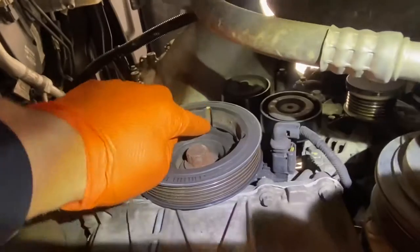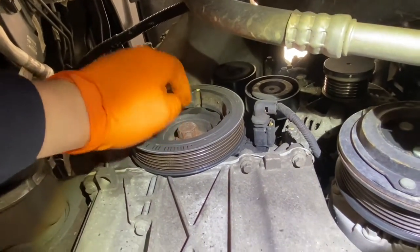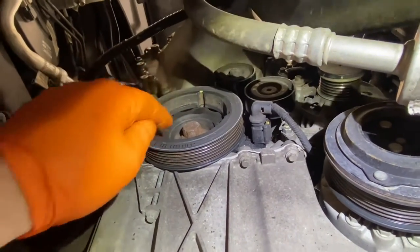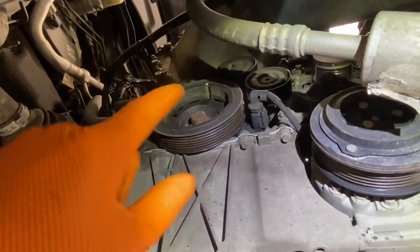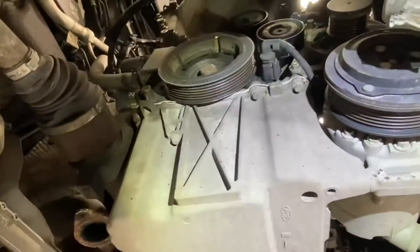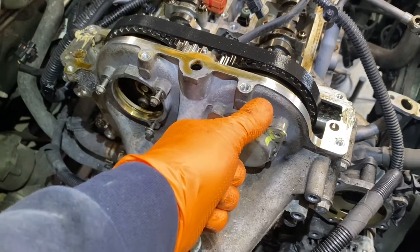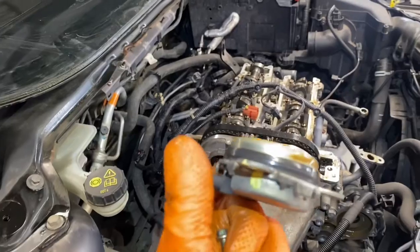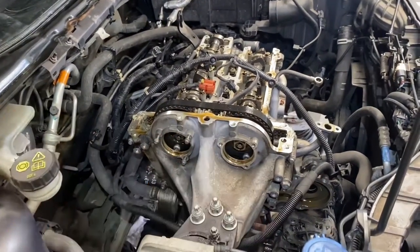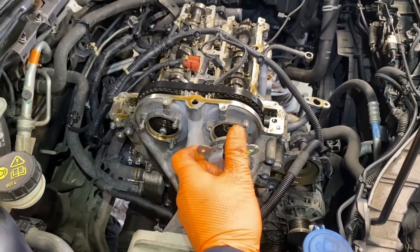There's another little pin to go in here to line it up. At this point I'm going to get the crank bolt open using a power tool like I did last time, then start disassembling. I'm only concerning myself with the bottom for now — up top with the camshaft timing adjusters, there's nothing to worry about. When the oil pressure controls that plunger it sends in or allows more oil to advance or retard cam timing, but you can unbolt them without fear. I'm just marking which position each goes in to put them back in the same place.